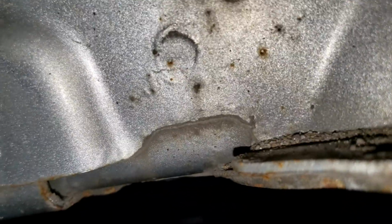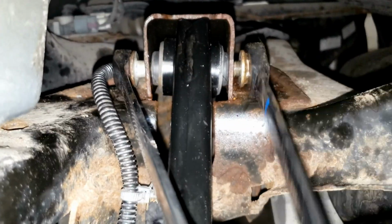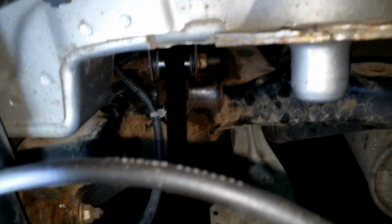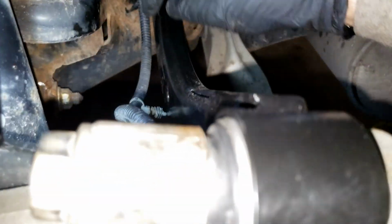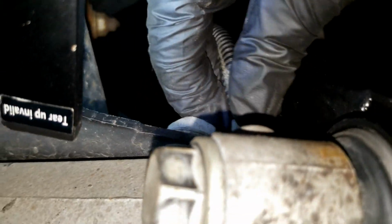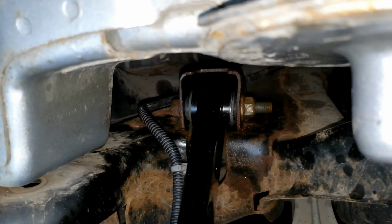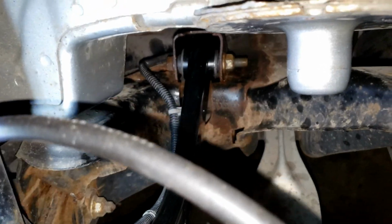And then come back in here, kind of same setup as before. Put 18mm on the nut, just drive it in slowly but surely. All right, so once you get your 21 and your 18mm all put back together, put that wire. This aftermarket part does come with actual pre-drilled holes, which is nice. A lot of them don't. So there, all those can go back in, minus the one that you chopped up back there, but it's not going to go anywhere.